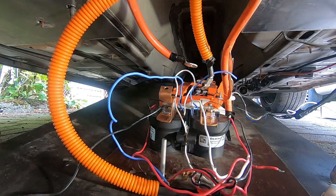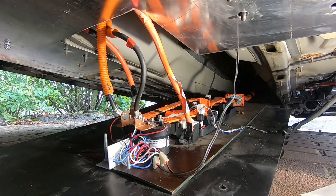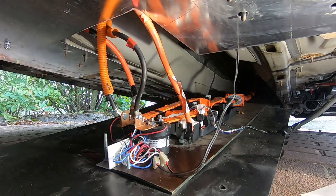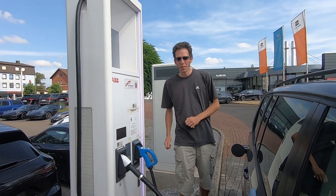That sequencing reduces the turn-on peak, and I've tested that in this case 1.3 amps are enough to close the contactors, as opposed to 2 amps when they're simply in parallel. Charge port plus and minus, battery plus and minus will all be merged together here. Time to close it all up — all done, let's do a charge test.